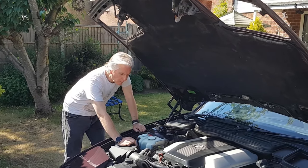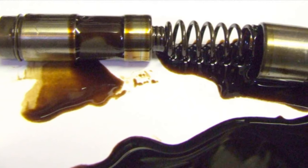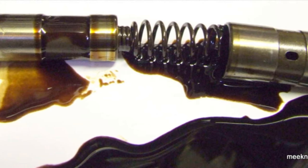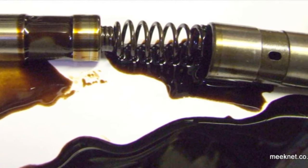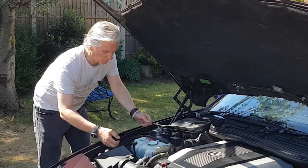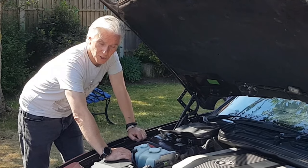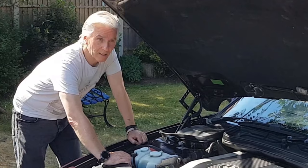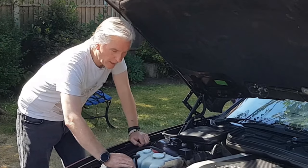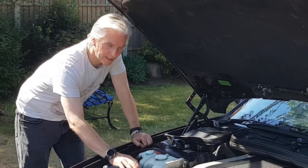Right, so what we'll do next is we're going to whip out the timing chain tensioner and we'll have a look at it, and I'll explain how it works, because it isn't just a spring that pushes out a piston, it's hydraulic. It actually has hydraulic pressure applied to it to provide enough tension on the timing chains because it's a huge amount of energy that's been put on them, and people don't realise, thinking it's just taking up slack. Well, it's not. It's putting a huge amount of energy onto the chain to stop it flying off the sprockets and stop it flying off the bottom guide rail as well, because that's the one it flies off, and the top sprocket as well will fly off. So you're not just stopping the timing chain guides from being damaged.